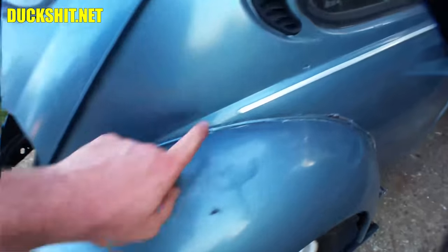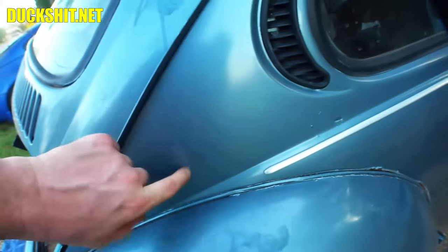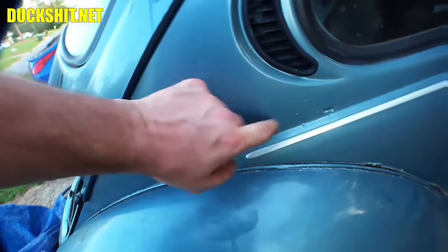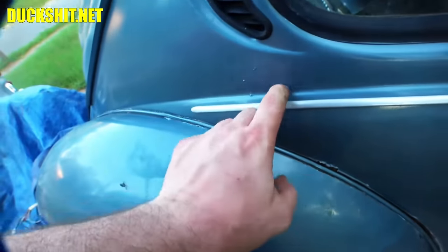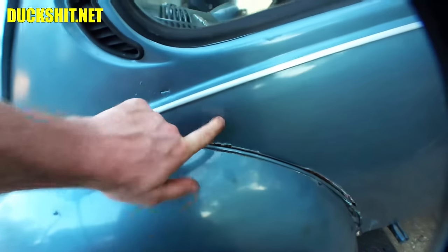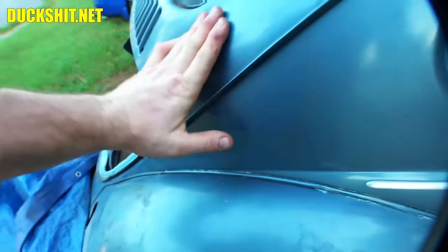This side is much the same way. You see somebody's weld marks they didn't grind off, but again, much more dense, but the drum sound is much more obvious over here. There's a little bit of filler here, somebody painted over a hole that they didn't properly fill in. But otherwise, yeah, all this is good. Nothing for me to cut out.